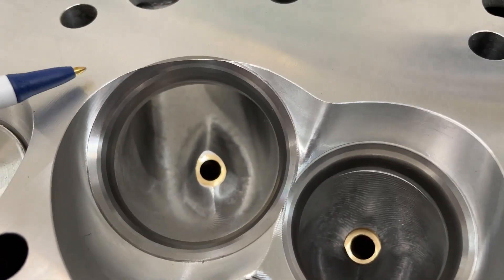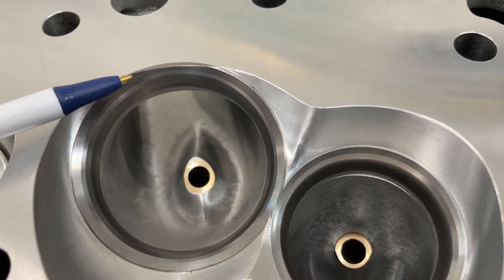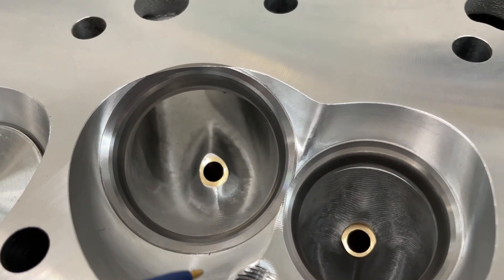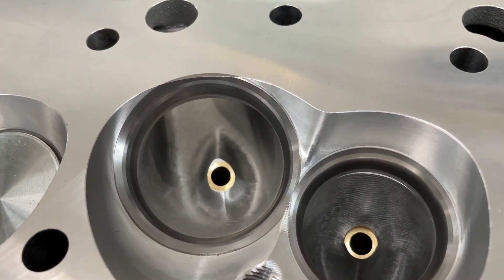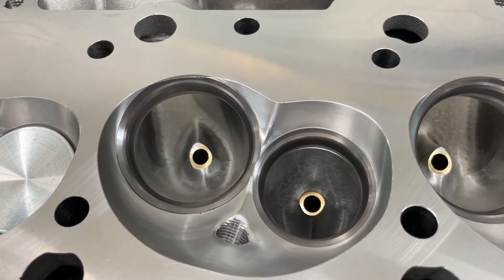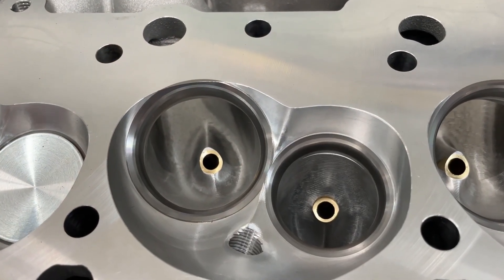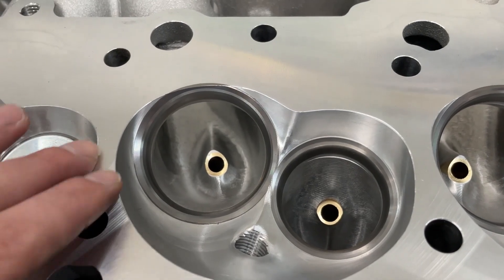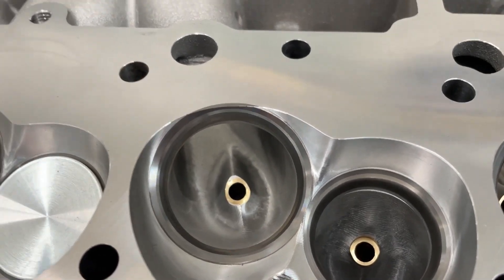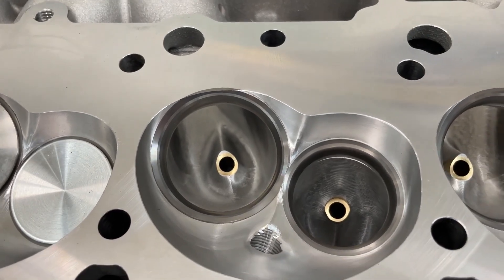This doesn't mean it couldn't be helped. One of the things you could do is take the valve job and sink it down until the top cut comes all the way back out. The catch is that as you drop down the valve job, the chamber itself will increase because the valve is sinking in. So the way I do it is to first mill a few thousandths more than I need to, to make up for dropping the valve job down so the chamber size ends up correct. It's got a pretty good amount of top cut — if it had none I'd have to do something.